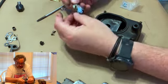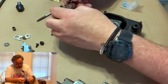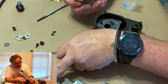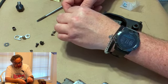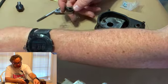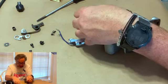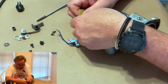So what we've got now, we've got a clean condenser. We've got points that are squared and polished. This is the end that they were using. This is the spring. This wire, and that wire on the box all fit together. So you want to have them all clean where when they're together, they have a good contact. All of them talk to each other. So we're going to lay that aside. We're going to bring this over here. Clean this little end. Because this is the one that comes from the coil.